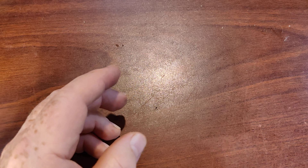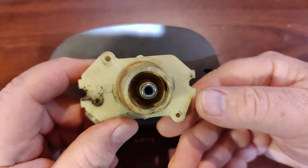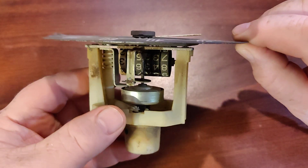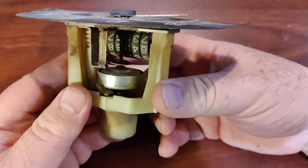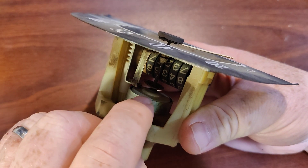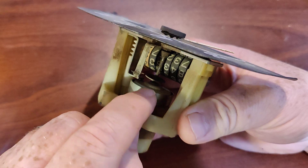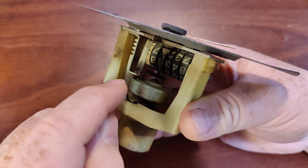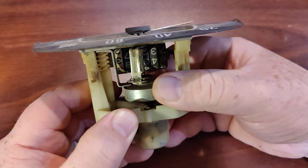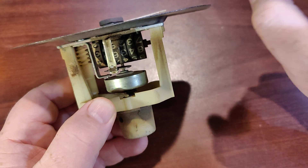Stepping back one generation — this is a screw-in speedometer type with a plastic body. They had a couple different models, but they're basically the same. These will go bad, typically through this outer housing here, which spins around. Inside of there, there's a little aluminum wheel that has one little round disc of steel on it. The faster this spins, the more the magnetism pulls that disc up, and it just keeps going around the outside, pulling the speedometer needle across. What happens is these get really loose, and they start touching that little piece of aluminum on the inside, grabbing it and spinning it.